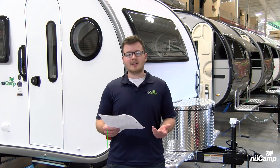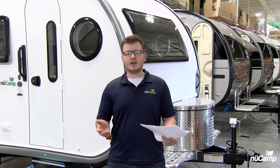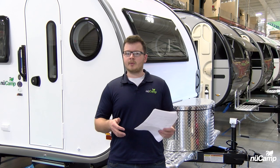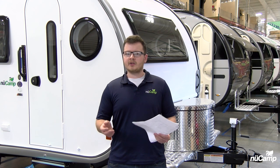Here at the factory. So this week's question comes in from Lisa in Washington State. She asks, what's the purpose of my battery disconnect switch? Great question. Your battery disconnect switch is going to cut off the battery from the rest of your unit. This will prevent any draw that you can have on the battery while it's in storage. It's also going to prevent the battery from receiving any charge.